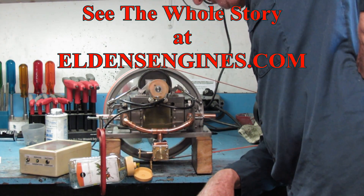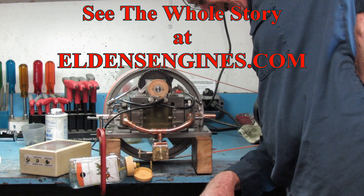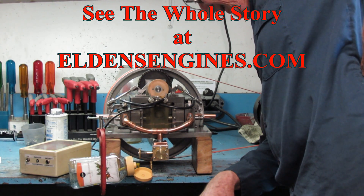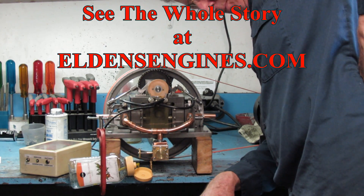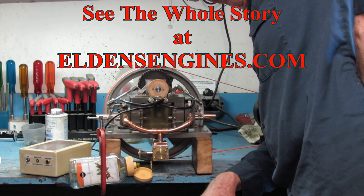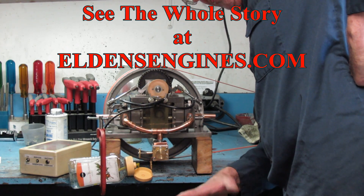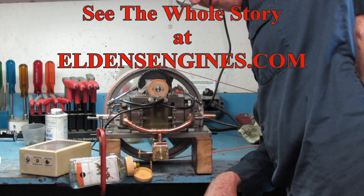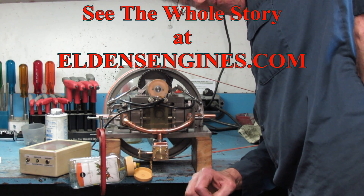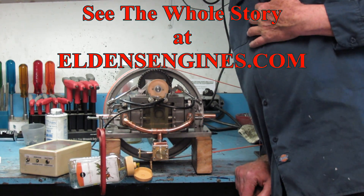So there you have it. She tries to run. I'll make up a choke for it and deal with the timing a bit. It has no piston rings in it, so I may put the rubber hydraulic O-rings in it and see if that helps any. It's running about 70 pounds of compression, so it should run. I think the problem mostly right now is timing and carburation. Anyway, that's it — another scientific achievement from Hoyt Claywell and Company.